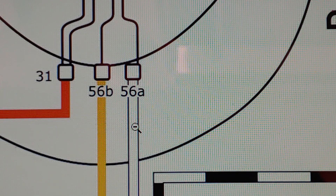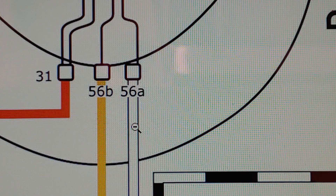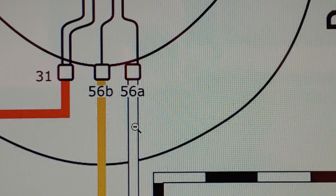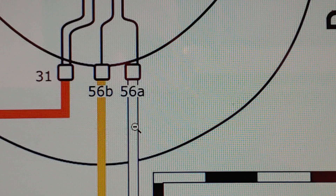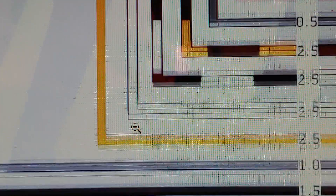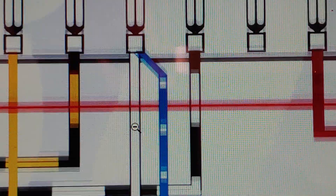These wires are going to come out behind the headlight. They're going to come into the trunk area or the hood by the spare tire. There's going to be two wiring looms or harnesses coming out of the headlight area. It's going to ride on top of the spare tire area and go up. This harness is going to come right below the master cylinder reservoir — right about that area. It's a solid white wire, and that 14 gauge wire will run right into fuse number five.